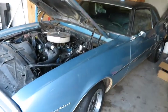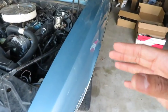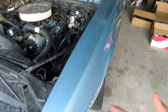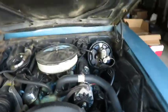So there's basically two ways to do it. You can use a spring compressor kit, or you can use a jack, which is what I have. I don't have a spring compressor, and you have to be really careful about doing that, only because there's a lot of potential energy in that spring being bound up like that, and if it releases prematurely, it can go flying. But so many people have done it before, so it's probably gonna be okay. Yeah, so let's get started.